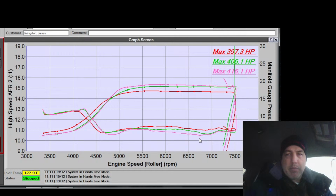Looking at my log though, 20% on the very top end is all it's taking to give me that 20 psi up top. 25 in the mid-range is not hitting my target. Oh wait, that's not that bad. Hold on a second. What RPM is that? 48. Yeah, so 25 is not quite hitting my target. Looks like it is though on the graph. But that boost error on the log shows that there's an error there.